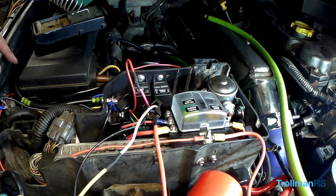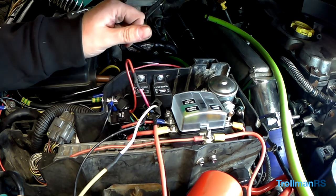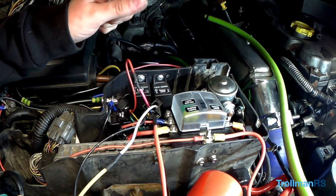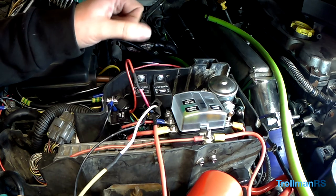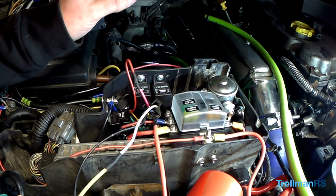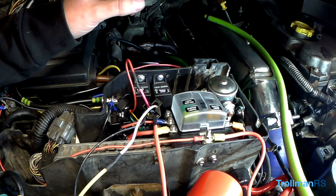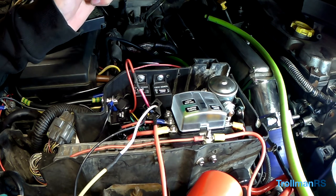I will eventually have to solder a wire coming from the switch, but I need to sort that out yet. As I said, I haven't got a switch. I need to find where I can put one, because there's a distinct lack of switch locations now. I might use one below the fog light and get a spot lamp cover for it, one of the factory ones. Use a latching switch.